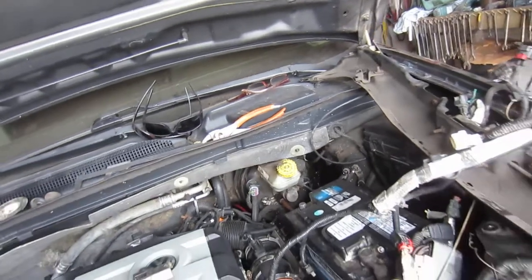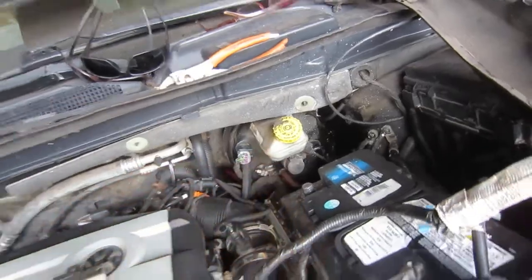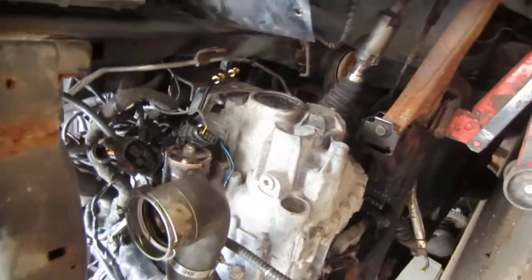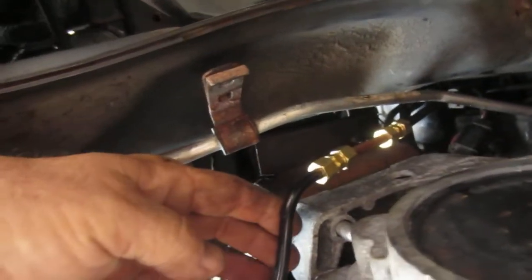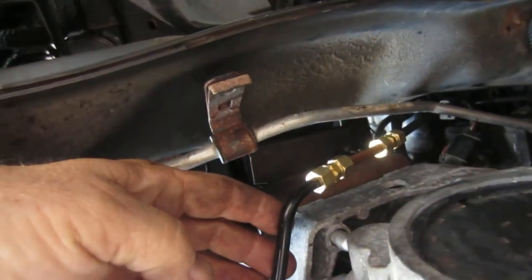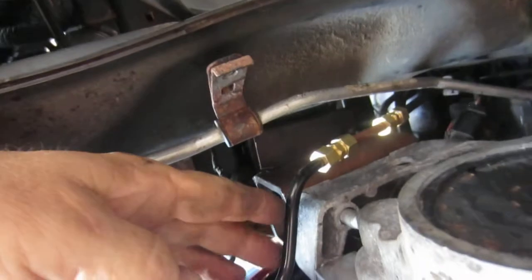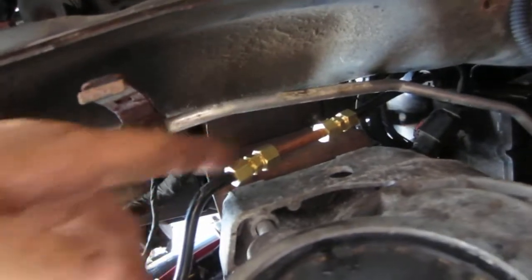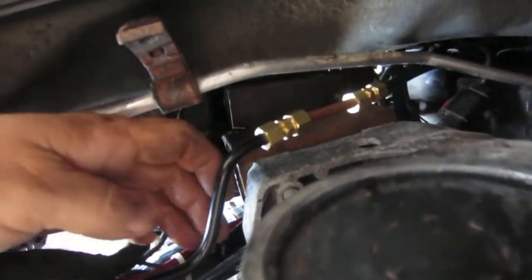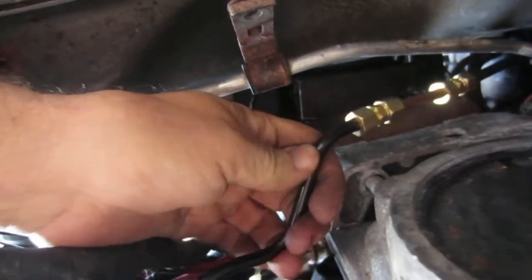I have the clutch system hooked up now with the hydraulic line attached to the clutch master cylinder, but the plastic hydraulic line is too short. It's a unique plastic pipe — 5/16ths on the outside with only about a 2mm hole in the middle, so it has really thick walls. I put a 3-inch piece of copper pipe in between using compression fittings. I believe I'll never have a problem because of the thickness and rigidity of this high-strength pipe.